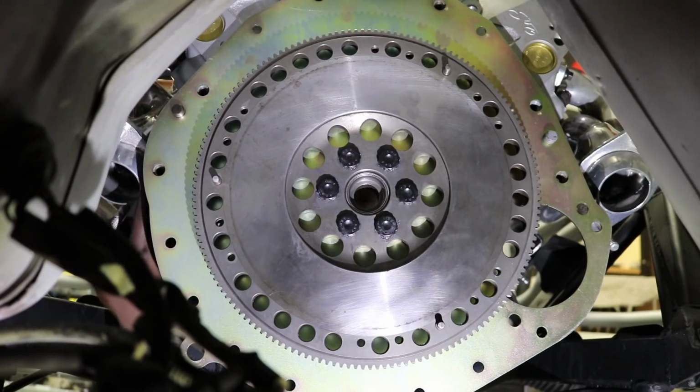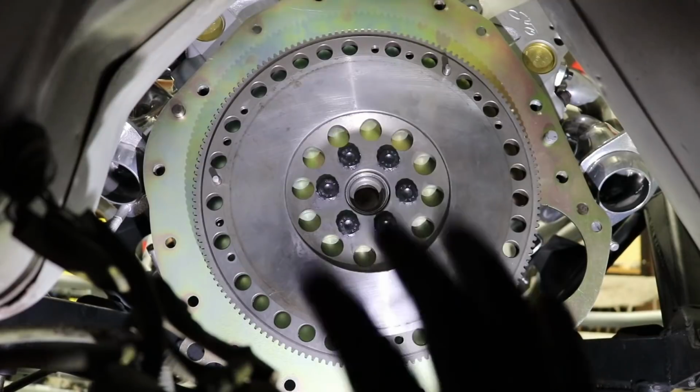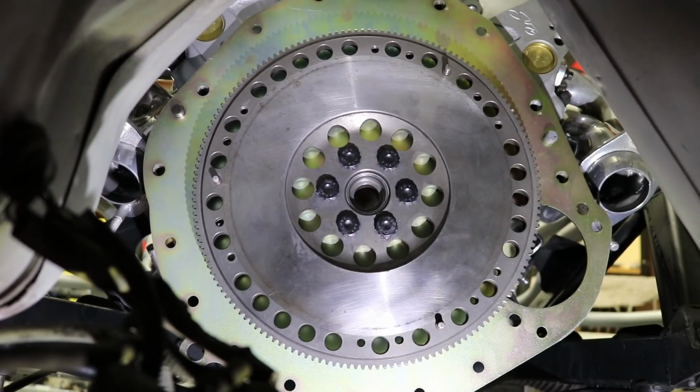Yes. And from the looks of it, the exhaust is super close, but it's clearing so far. And like I said, we're going to see where this transmission sags to, because the mount's back here. And I'm thinking I'm going to have to end up redoing the mounts. And then I also got to cut off these. It's got subframe connectors under here that I don't want, because I want to use the Maximum Motorsports subframe connectors. So I'm going to cut these old ones off and add the ones I want to use, which looks like a whole lot of work. These guys did some stuff that I would prefer it was not here. But whatever, you gotta deal with what you got.